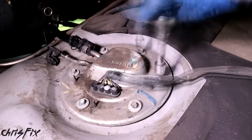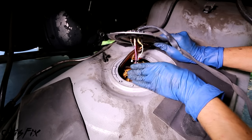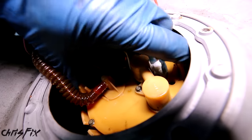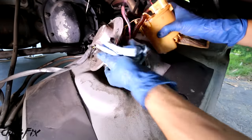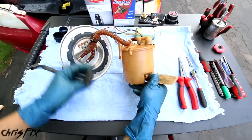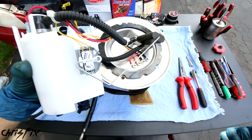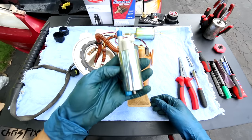Now we're going to remove all six bolts holding the cap on the gas tank. But before we do that, remove this wire from the sensor back there — just pull the pigtail right off the sensor, so our entire wiring harness is loose. Now we can remove the six bolts holding the fuel pump assembly in. With the last bolt out, pop the lid off — be careful not to break any of the hoses. Looking into the fuel tank you can see the fuel pump assembly. There's a clip on either side — push those inwards and pull the assembly out. Wiggle it the rest of the way out and be careful with the float because you don't want to bend it or your gas gauge won't be accurate. You could get a whole new fuel pump assembly, or just replace the fuel pump itself — that's exactly what I'm going to do.